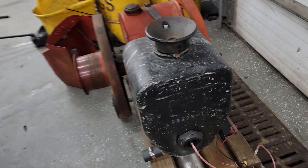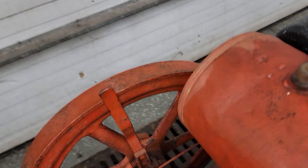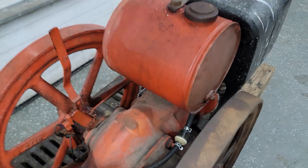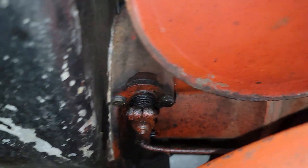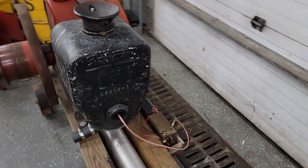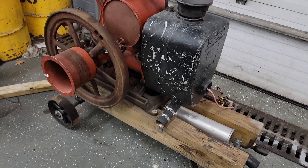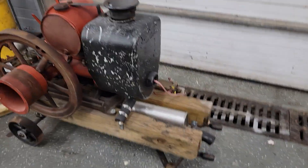This engine has a few updates compared to the other - it has a tank bracket to stabilize the tank, a minor upgrade on the ignition system that's plastic instead of metal, and it had a spring return on the throttle valve that my older engine did not. These are upgrades through the model years. It's a runner, so we're going to get it on taller wheels to be more stable, remove the front legs, put it on wheels, and make a nice pull cart so the tractor can pull it around.